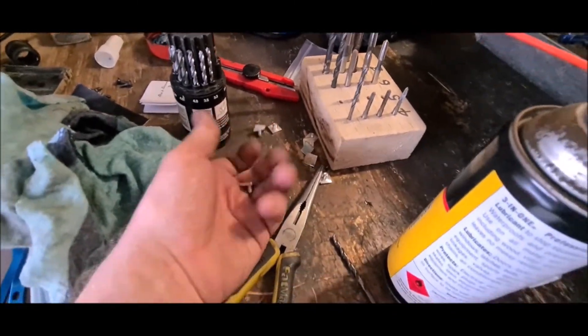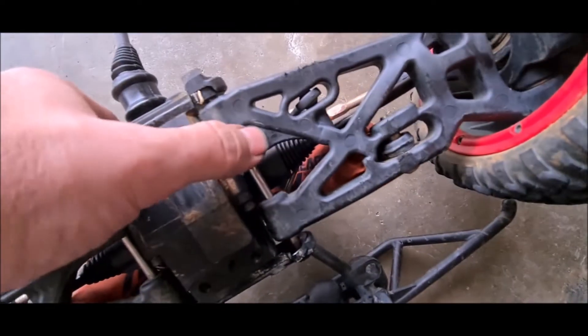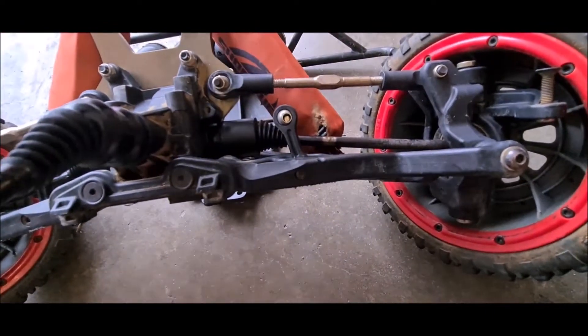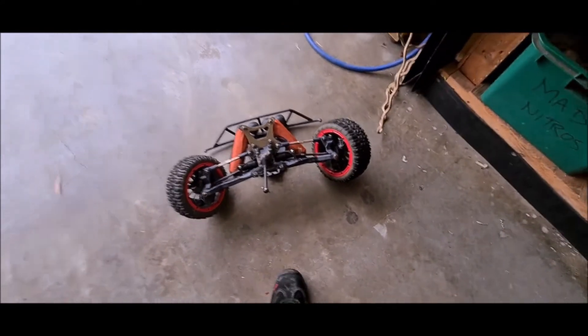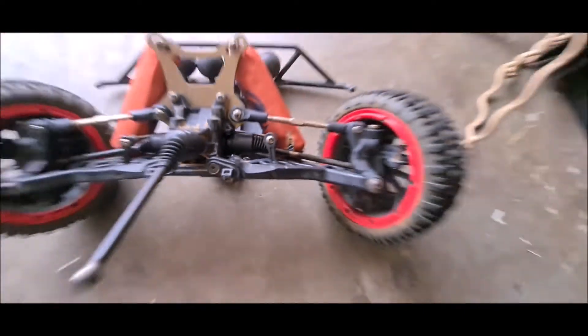Here in Australia I got these from Steve - gave me a good deal. I bought two sets and never fitted them. What they do is - the droop screws, if you screw that in it'll push the arm up. It's a system to sort of save the suspension. If you have droop screws set up a little bit higher, your shocks don't have that pressure going against them when you're in the air, because gravity pulls the suspension down and affects the shock.